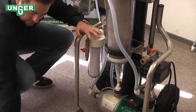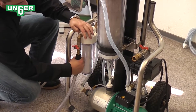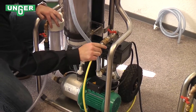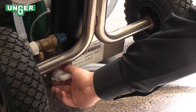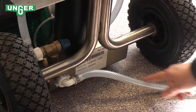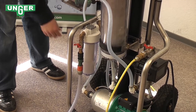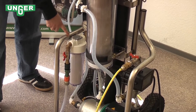Okay, so let's get started. This hose comes from your tap water and you're going to connect it right here to the pre-filter. This hose goes from where the clean water comes direct to your pole — you're going to connect that right at the end. This is your concentrate hose; it's already attached, and this is where the concentrate is going to go back out. When the machines are shipped, they're shipped in conservation mode. The first thing you need to do is turn this valve on, allowing the water to go through your pre-filter.